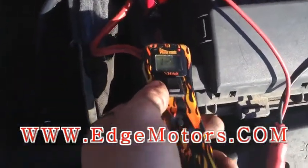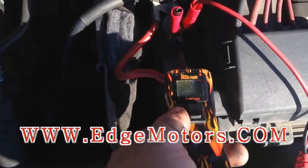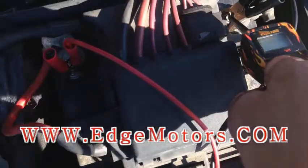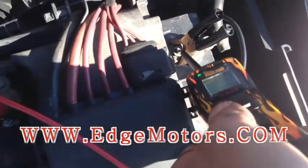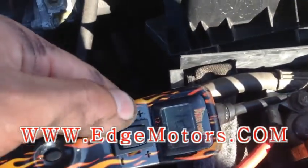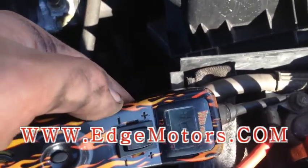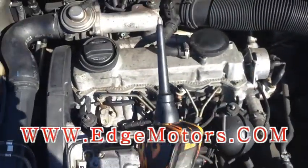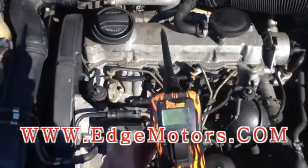Attach the positive — you can sense the 12 volts in there, it tells you if it's positive or negative, what you've got in there. Attach the negative and it tells you there is ground, and the digital display shows how many volts you've got. There are a couple more options to it — it's a very good tool to have.